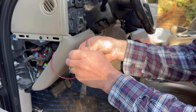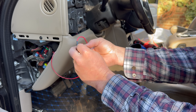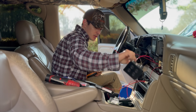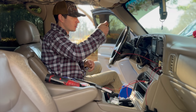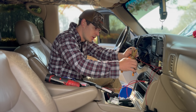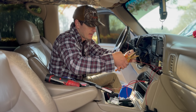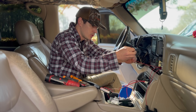Found it — the ignition fuse, 10-amp, ignition three. Alright guys, we are wiring everything up. Already hooked the ground wire up to the switch and ran it just like the trigger wire through the dash. We're hooking it up to the negative at the hood ground. We're about to hook up our power to the center pin on the switch, and then our trigger wire goes on the bottom. Strip that down and throw our heat shrink on there before we forget.